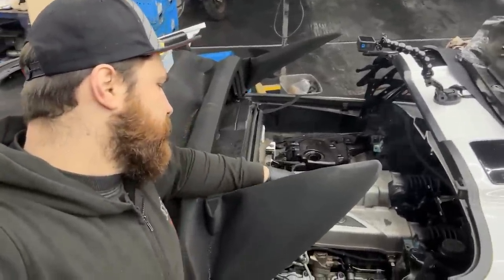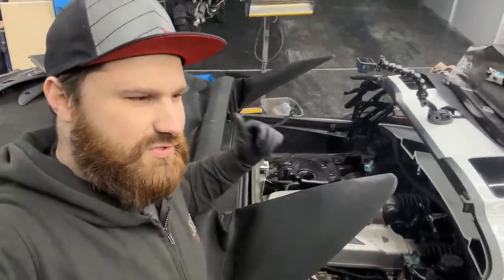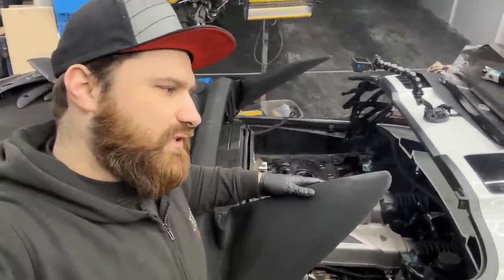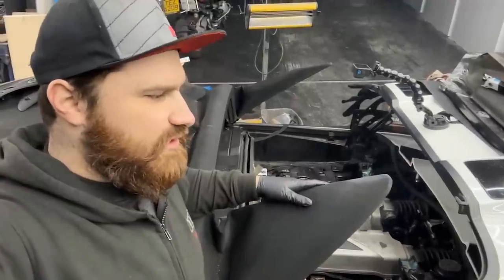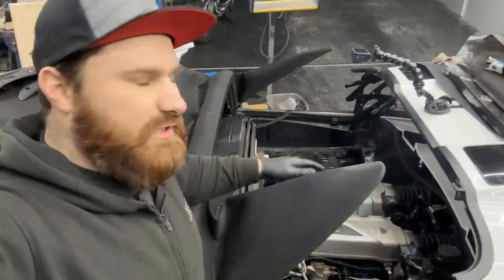The connector for the throttle body on bank one wasn't really pushed in properly, so there was a throttle body fault code that was erased. The engine was restarted, was running much smoother, much better. So I left it running now for a couple of minutes.